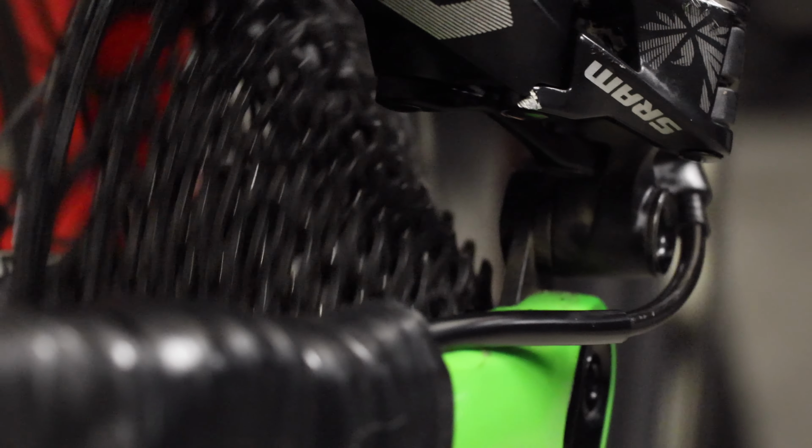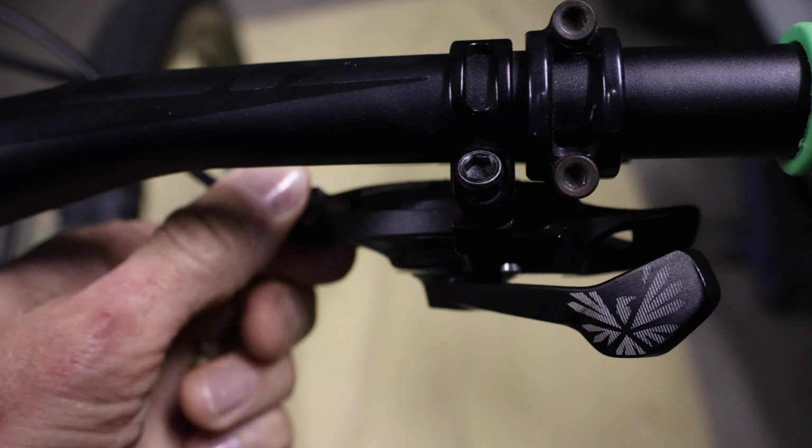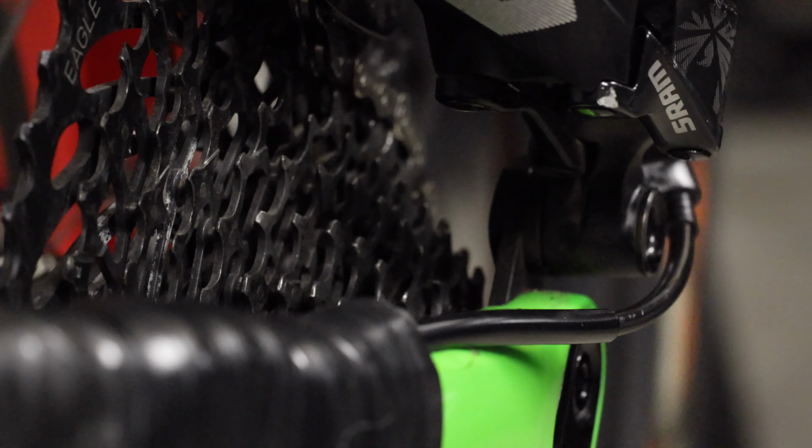Second gear, right up on the first gear, selecting it, not dropping off the sprocket. So it just needed about a full turn of cable tension just up on the gear selector. Now it's going to release through all the gears. Second, third, fourth, fifth, sixth. Just check it on 6th gear, still perfectly over the sprocket, the jockey wheel that is.